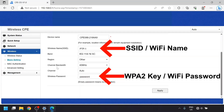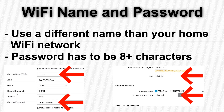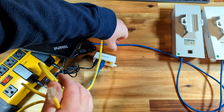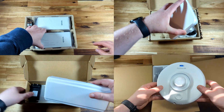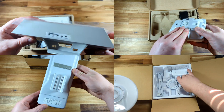Most bridges will need you to come up with an SSID — the name of the wifi network the bridges use to talk to each other. The only thing using this network is the other bridge, so don't make the SSID too close to your home wifi name to avoid confusion. You'll also want a password at least 8 characters long. With all this figured out, you're ready to set up the bridges. I'd recommend going through all the configuration before physically installing them so you can make sure things are working without running between two locations. Since configuration differs between brands, I've made individual videos for a few different models linked in the description.